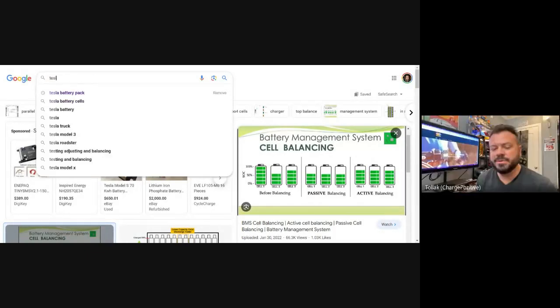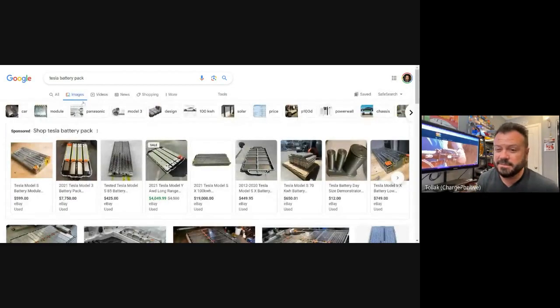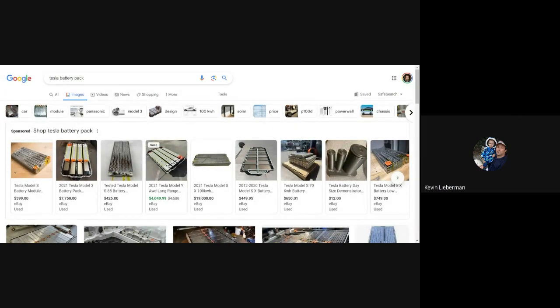So Ron, when we were doing the summer bus, we were talking about trying to keep the pack within 5 millivolts, right? I can't remember, but that's a Kevin question probably. But we had an issue over the summer. The closer, the better, basically. But the tolerance is set up in the BMS. When the BMS decides they're too far out, it'll tell the car to stop driving.